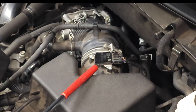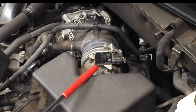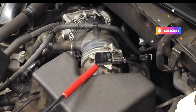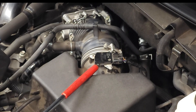Just circling back really quick: if you get those P codes, check this item. If there's oil built up on it, try to clean it first because that could solve your problem. If that doesn't solve your problem, you may need to replace the sensor itself, and I just showed you how to do that. That wraps up my tips. I hope you guys found them helpful. Please like and subscribe, and until next time, drive defensively.